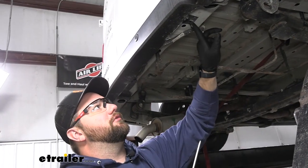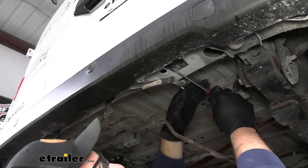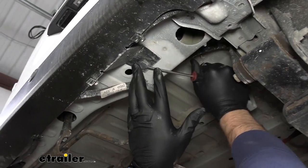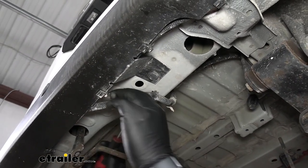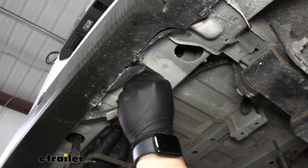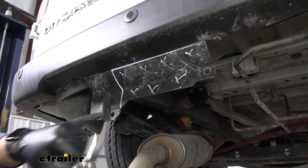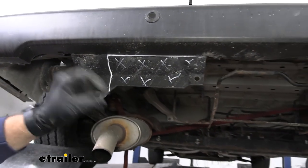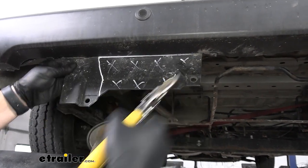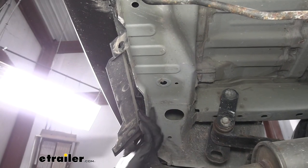Now we need to take a flathead screwdriver and remove two pushpin fasteners from underneath — they're holding these little tabs on. We removed the driver side already, but for the passenger side, take a flathead screwdriver or a trim panel tool, push it under the middle portion of it, pry it out, and then pry out the base. Set these to the side. We're going to take this tab and fold it down so that we can have a better look at it. In your instructions it's going to mark out — it is a really small picture — but we'll mark it up to the crease line and then go straight across because our access hole for a bolt is going to be underneath here, and we're going to need to use that in order to attach our hitch.